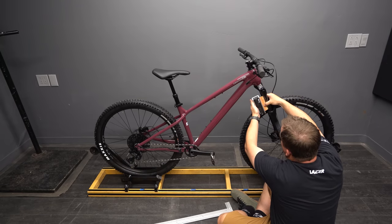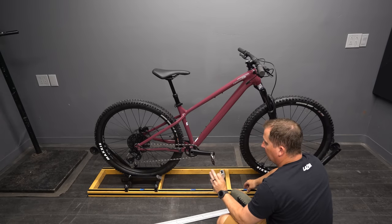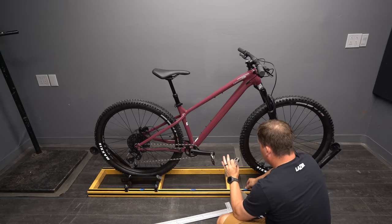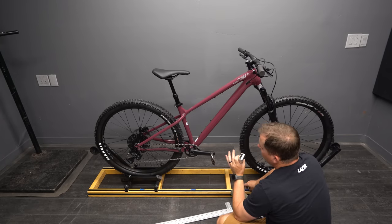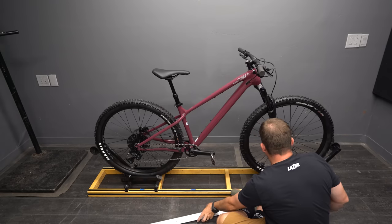Head tube angle 65.0 unsagged. Now it said 64 degree online, and I'm actually glad it's 65 and not 64. 64 is really slack, and there are a few places to really wake one of those up. So I'm actually glad it's not as slack as it shows online.